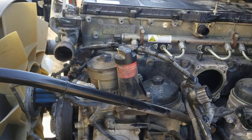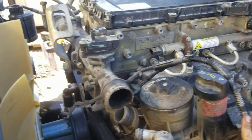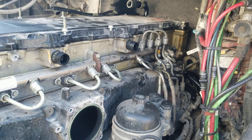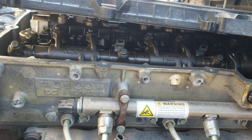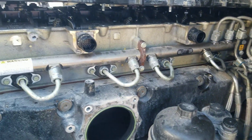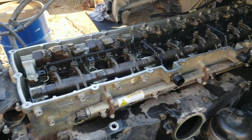On the driver's side I took the tube that goes into the intake off and undid all of the wiring harnesses. I haven't taken the lines off just yet because I don't want any debris going in there — I'm going to take those off last and somehow cover them so I don't get any debris in there. Then I'll be removing the wiring harness for the injectors, the jake brakes, and the cam housing.